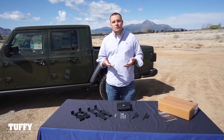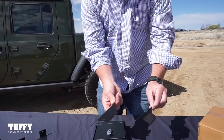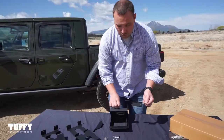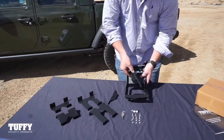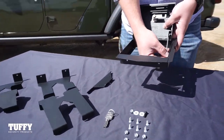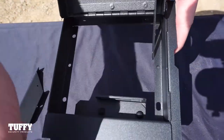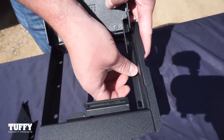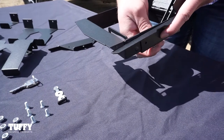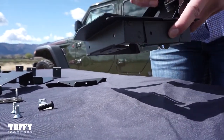Following the instructions, we're going to start with the right and left fill panels and get those installed first. Here's the left and here's the right — the right is going to have a little bit more of a triangle to it. We'll do the left side first. Imagining we're in the vehicle at the console, lift the lid, angle this piece down and in, it goes underneath the frame and then slides up into the side. You'll know your correct orientation when everything lines up and you can see through the hole. Feed your hardware — a Phillips head screw down, then try to get the nylock to tighten underneath.